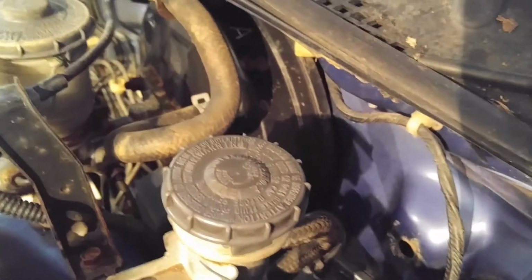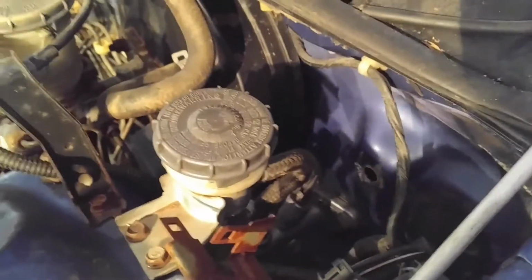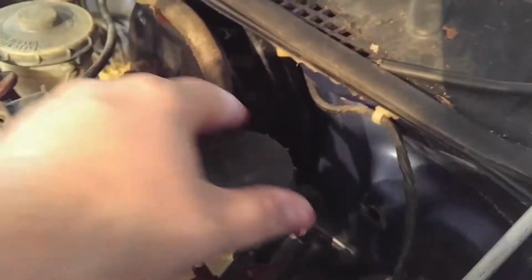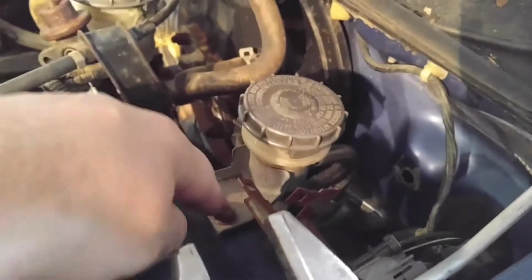And then you need a clutch master cylinder, which is right there. The hole is already there for the clutch master cylinder. There is just a little plate, and there's a bolt there and a bolt there, but they're on the inside. And you have to put those in with the pedals, and then this just bolts right there with two 10mm bolts. So that part's really simple.